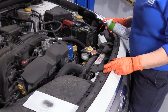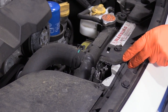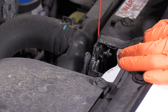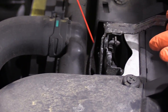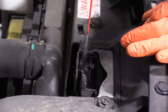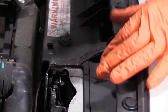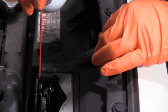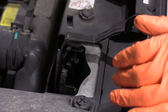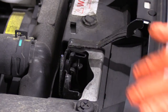So on our safety latch on the Subaru, it sticks down — see it? Sticks over. The spring is trying to pull it back and halfway it finally takes over. So I'm going to spray it with my dry lithium graphite. Work it back and forth, just the same way you would with an oil base. After a couple of sprays, let it sit in, work it back and forth, and it's good to go.